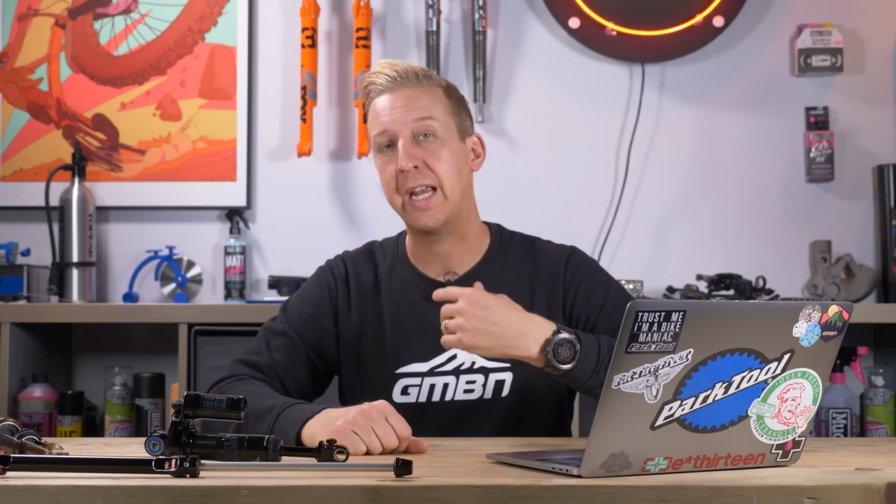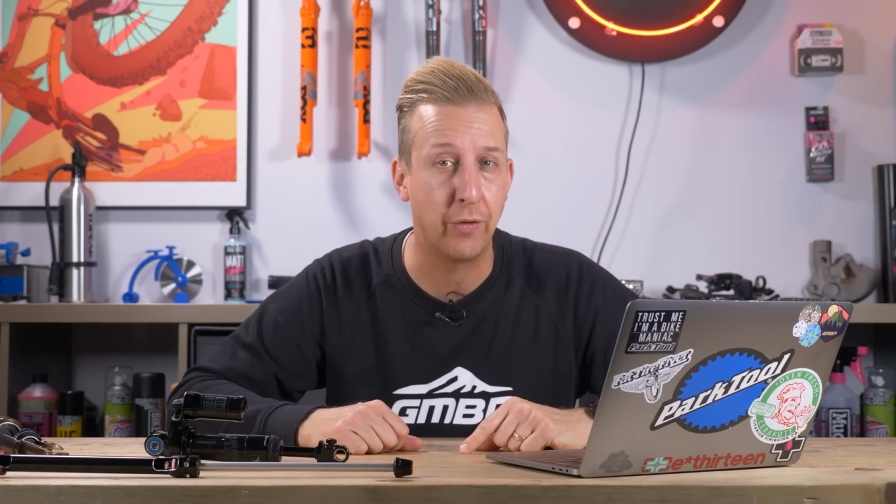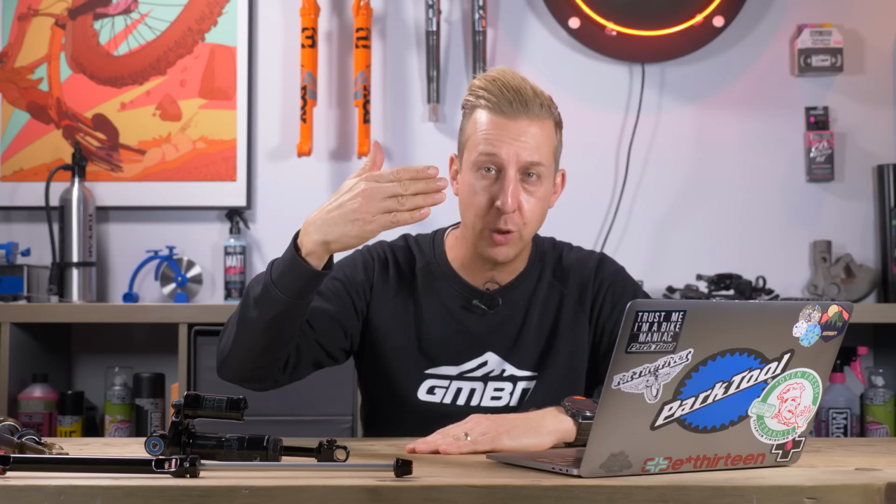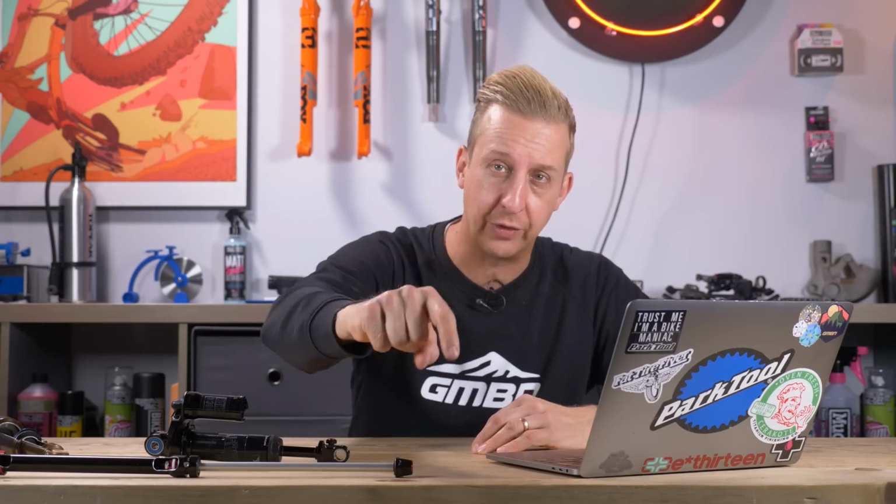Depending on what fork you have, let's just say you're looking for 25% sag and your fork has 100 millimeters of travel. So 25% of that is 25 millimeters. So you're looking for 25 millimeters of sag, which is the amount the fork moves under your body weight when you get on the bike. And then adjust your air pressure accordingly. Again, we've got videos on setting sag in the description underneath.